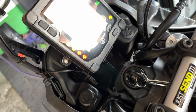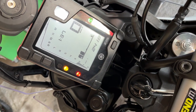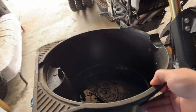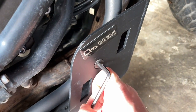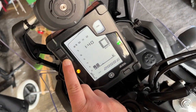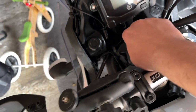The first thing you want to do is start up your bike and get that oil nice and warm. I wait until the temperature gauge on the T7's dash reads about 50 degrees. I know that's water temperature not oil temperature, but it seems to be warm enough. Water temps are up to about 50 degrees, which means the oil has a little bit of temperature in it.